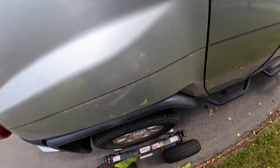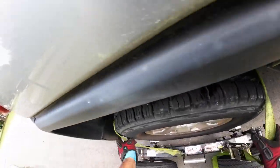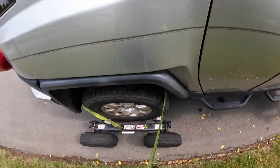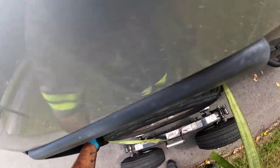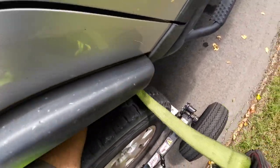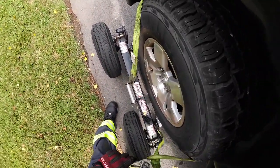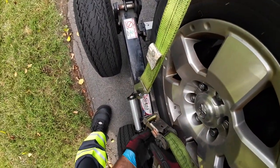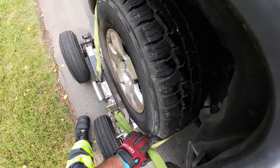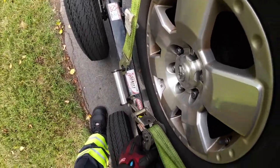The tie rod, if some of you don't know what it does, is connected to your rack and pinion, which is all connected to your steering wheel when you're turning. That's what turns the wheels left and right. So what happened here with this truck? Is it crooked? Twisted? When you're turning left and right, that's what controls the wheel to turn, and his tripped right out. So while he was driving on the road, the wheel basically didn't know which direction to go, and it's going left, right, left, right, which is what was causing all that crazy vibration and jumping around.